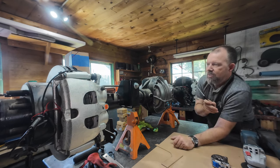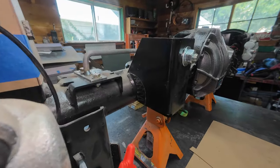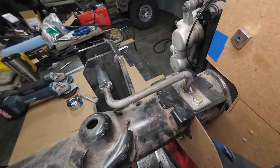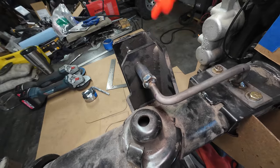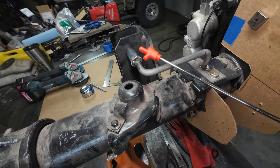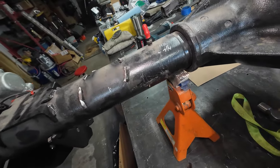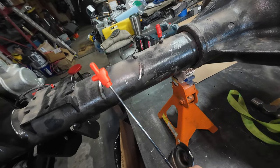So that is going to be next. I've got that all marked out — you can see the markings for the cutting, there's one on the other side and on the bottom, and I'll just trim that to fit. And here's that jig basically to help line everything up, and this is the spacer that will come out. This does give us one more problem: the coil mount. If you move the axle back that direction, the coil mount needs to move forward. So I will be taking these coil mounts off and building a new coil mount. I went through and marked where the center of the coil mount is, so I will build a coil mount that moves it forward.